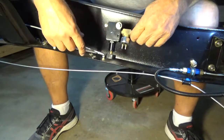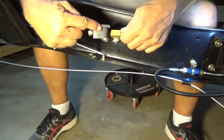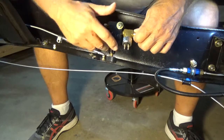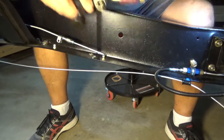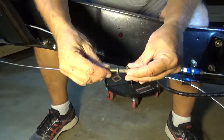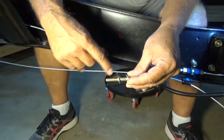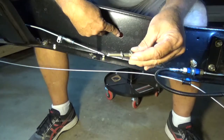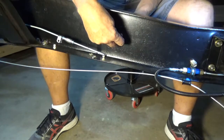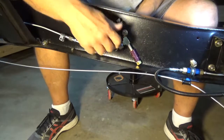This is going to go in just like this, where the proportional valve adjusting knob is here. That quarter-inch spacer plate right there was put there so that my handle here would not rub on the frame. The mounting bolt is going to be a five-sixteenths bolt. I cut a three-eighths nut in half to serve as a bushing to go inside this hole right here — I've got that on my two-and-a-quarter inch five-sixteenths bolt. I'll slide that through there and mount this assembly, leaving the brake lines a little loose to allow some flexibility in connecting them.